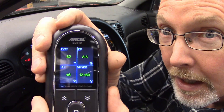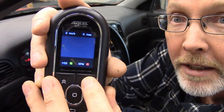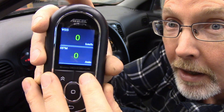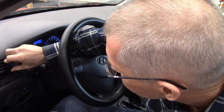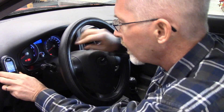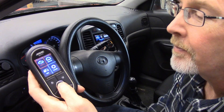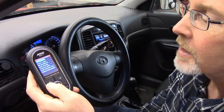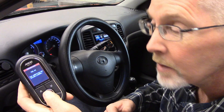The meter kind of thing — you've got a couple of different screens you can put on there to make that look decent for you. There's a bunch of different stuff you can have on the screen while you're driving. Cool feature with this: it comes with a little stick-it-in-your-vent magnet thing which sticks to the back, and I can put that in the vents of my car right here and watch it while I'm driving, which is kind of handy. You can go up to OBD2 and it'll connect, check if you've got any check engine lights, and talk to your car in a variety of different ways. You can even go to data stream and see what your car is doing. Let's fire the car up and see what it does.